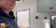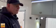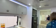So with the inverter, it's going to look after all the heavy use 240 stuff, which is your microwave, like your power points and aircon as well? No. Your fridge you run on gas, and that's why it's complaining, because I'm not plugged into the mains power at the moment. So I'll just reset that to stop it from beeping. Just hold this button down here for a couple of seconds. So when you're off shore power, the fridge is gas. The fridge doesn't go through the inverter. Is that right? Correct. So that saves your batteries. Yes, that saves your batteries.